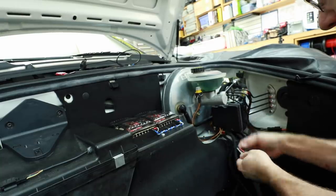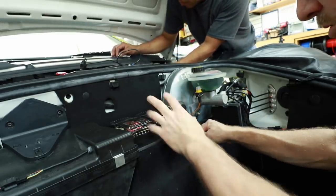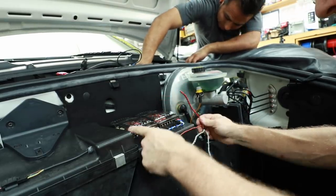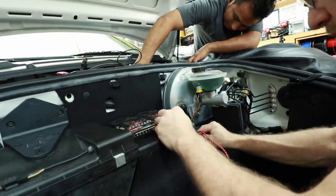After that we apply more tape to the wires going up to these crossovers. Because of where I wanted to cut them to ensure I could still reassemble the factory plug, two of these wires are going to be short to reach the crossover, so we'll be lengthening them. The other two will reach, so we'll connect those two first.